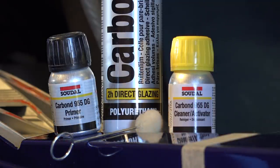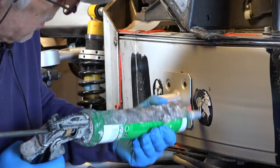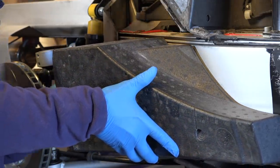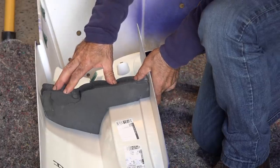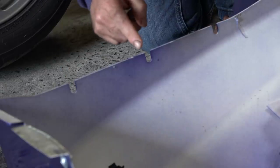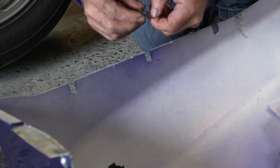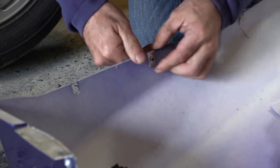These products work fine and if something works well I might as well say it: polyurethane glue bonding the sill to the aluminum body, the carbon cleaner and activator, and the carbon primer. I'm going to apply some Tech 7 to hold the crash cushion in place and mount it before I put the sill back on. I'm aligning it and making sure it fits properly. I also installed the foam in between the sill and the chassis making sure it was on the same distance. The cutouts at the bottom of the sill hold a clip so the aluminum plate underneath can be bolted onto the sill.